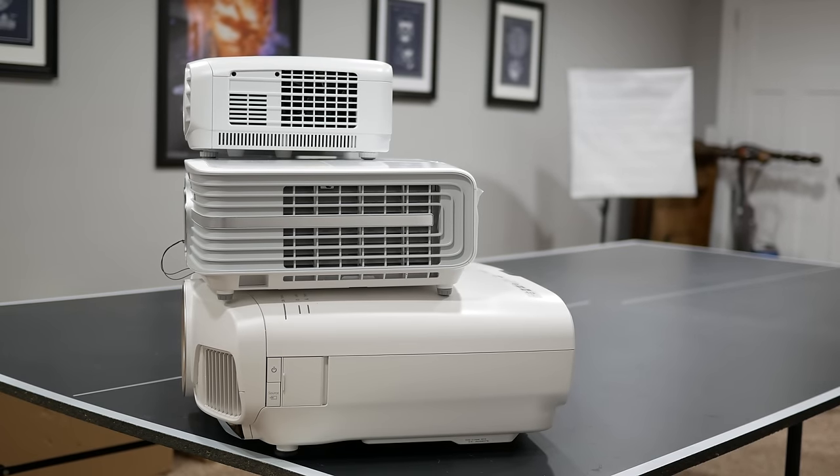They're probably 2 to 3 times bigger than a standard projector. Now, another thing with that is these larger projectors, they don't use keystoning. Keystoning is this effect where you have a trapezoid, essentially. Ideally, your picture is a square or rectangle with your 16:9 ratio, or there are other ratios as well, but you can actually tilt them out a little bit. So when you're angling it down, you can adjust the width of the top or the bottom of the image to make it still present as a rectangle or a square on your projector screen.